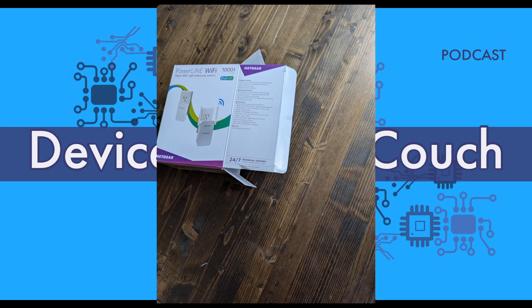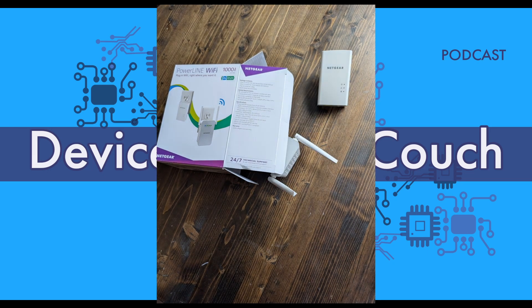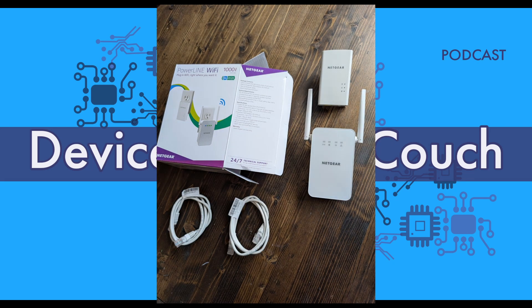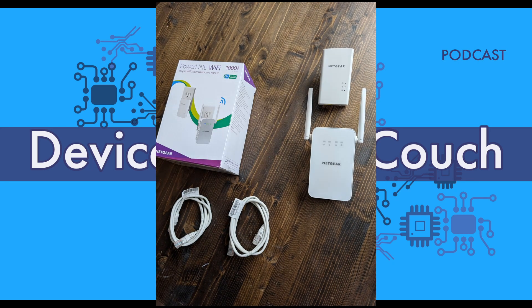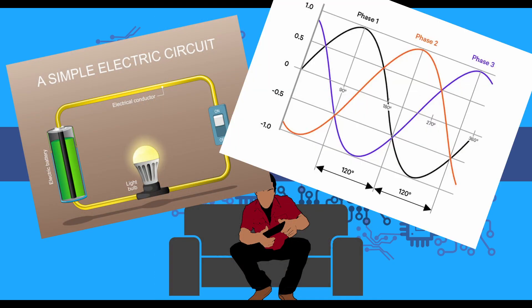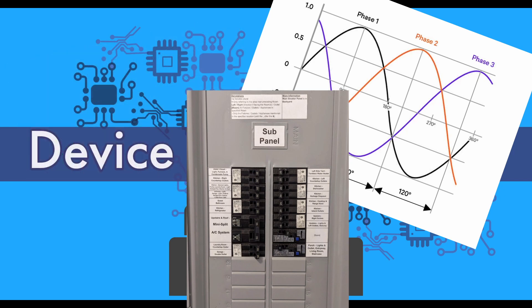This is the one I got. It says it can handle gig speeds — I pay for lower speeds at my place, but I didn't want it to be hampered at all and just see what it could do. This is what came in the box: the PL or Powerline adapter, the PLW or Powerline Wi-Fi adapter, and two small Cat5e patch cables. I read a lot online when researching these about circuits and phases, and making sure to check your electrical box diagrams, because that was a huge problem with signal loss.